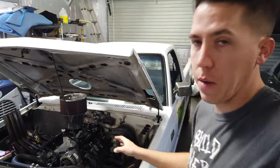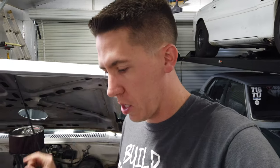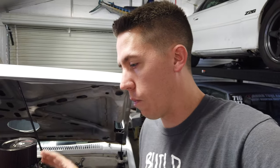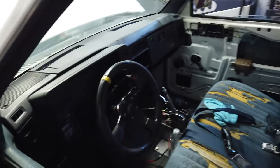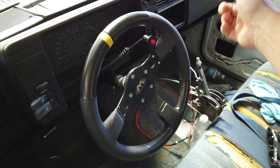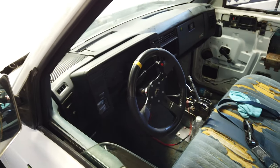I think a dry nitrous kit is a good idea for something like a burnout where you're on and off the throttle a bunch. I'm going to use the Holley to make sure we're not spraying through rev limiters and stuff like that. The dry nitrous — I'm curious — this is something I've been wanting to play with and tune using the Holley. There's a lot of ability to tune and control it. I can spray this from 2,500 to say 4,500 or 5,500 and then turn it off, so at 6,000 or 7,000 it's not spraying. Originally I was going to have a two-step button, but this thing hits the rev limiter pretty good. So maybe I'll use the second stage — one stage automatic, second stage on the button. So as I'm doing tip-ins, clicking into high gear, grab the nitrous and see how that goes. Lots of cool things you can do now with nitrous and all the EFI stuff.